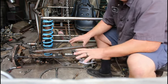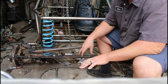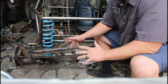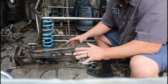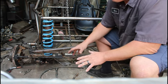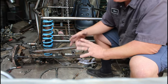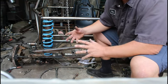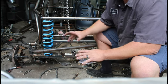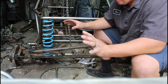All right. Now the front suspension. Conventionally on these buggies, from the time when people started building buggies, they would effectively just take the front end from a Volkswagen Beetle, whether it be link pin or ball joint, and set that up. It would already be attached to the pan, or they would just buy clamps and bolt it directly to their tubing frame, and Bob's your uncle, you had steering. It was effectively no different than how it came on the car.